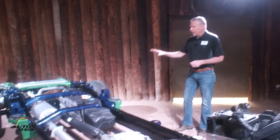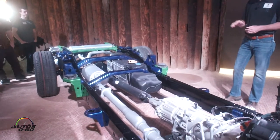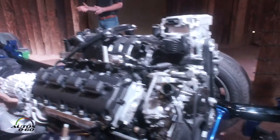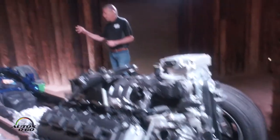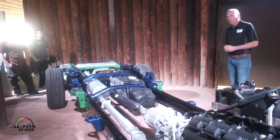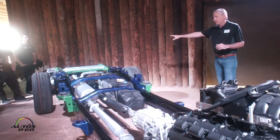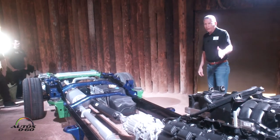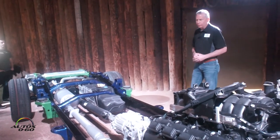The colors coordinate with the kiosk. The black section is advanced high strength steel on the frame rails at 110 KSI. Our green is also advanced high strength steel at 85 KSI, used in strategic locations like the rear for impact, our C-pillar mounts, our A-pillar mounts, and where we connect our lower control arms.